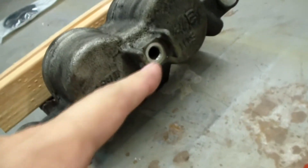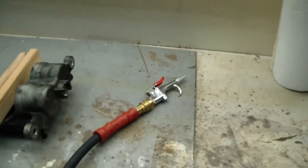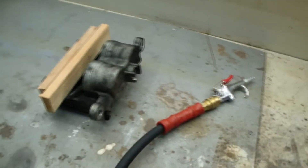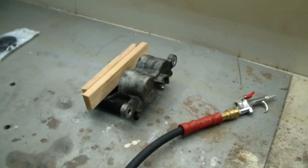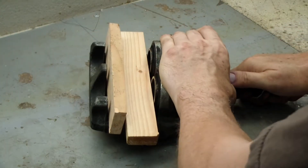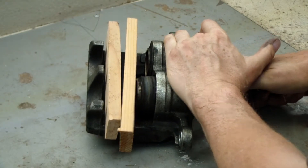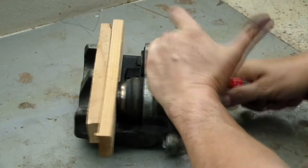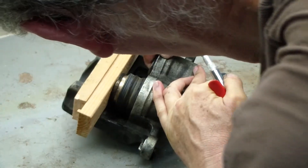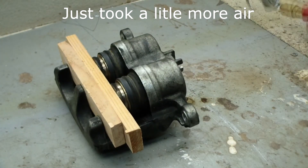The hole where we had the brake line hooked up is right there. I've got some compressed air — it's just got an aluminum fitting on there but I think I can still make this work. I'm just going to jam that in there and try to blow out the calipers. We put a little bit of air in there and one piston is coming right out. The other one appeared to be stuck, but there it goes — that worked. That's all it took.